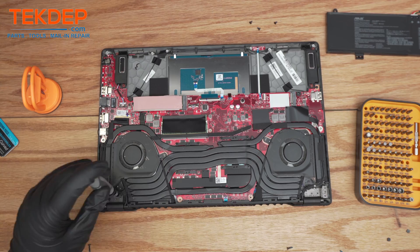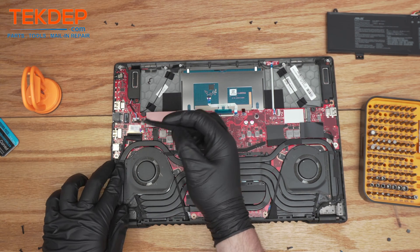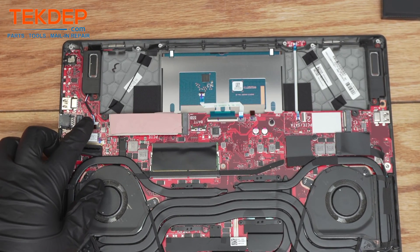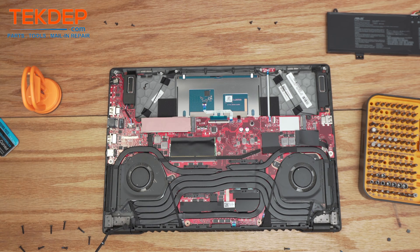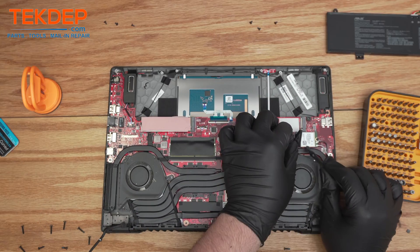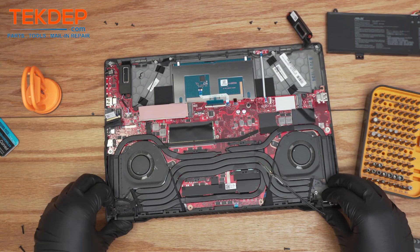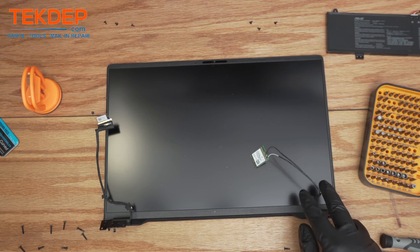There should be just three screws per side for the hinge screws. I'm going to start by getting rid of this tape — it can be on there pretty tight. There's another cable down here. Now we'll lift up this plastic flap to access the connector. These are pretty easy: lift back the plastic and just slide them straight backward and they come right out. For the other side we do the same — there's a screw right here, unscrew it, and it slides right out. Be careful of this hook; you can just go around it. And they're disconnected — that's the screen right there, just with these cables, and I can put it off to the side.